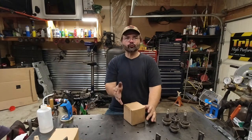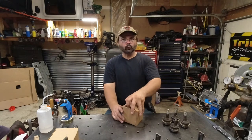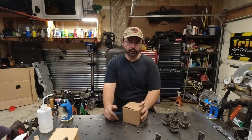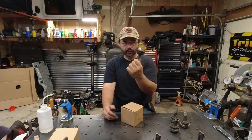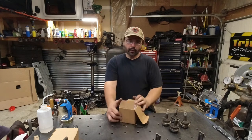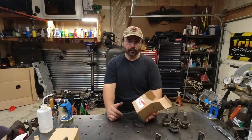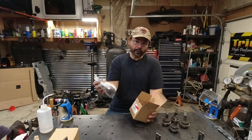Now this is the 1st of August of 21. And there's only a couple options for new ball joints. We welded on that truss onto that Rubicon axle. So if you weld on C gussets and everything, take your ball joints out, otherwise you'll cook them. Now Dynatrac has a set, but quite frankly, I couldn't go to $600 that they wanted for those ball joints. I know you get what you pay for.